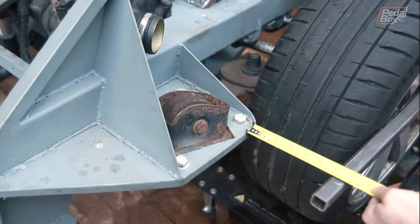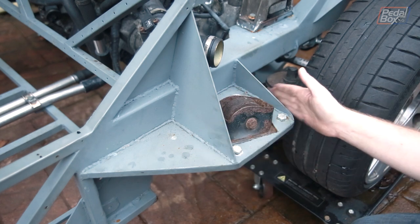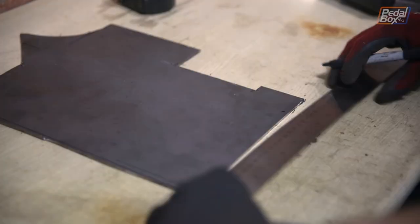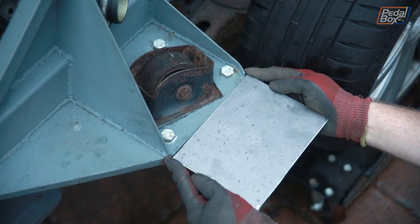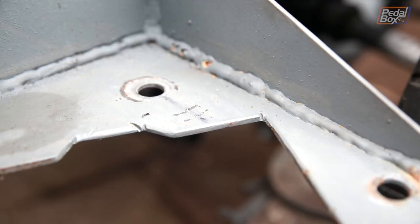Using an inanimate carbon rod we can put this across the side of the tire and see how wide we're going to have to extend it to. To the very outside edge of the tire where the rim protector is, is about 150mm. The plate as it stands is also about 190mm from the back to the very bottom edge. We're not too worried about extending it further because we're only moving it about an inch. This extension is just to keep the bolts captive and so we can mount the intercooler to something. Now we've unmounted the trailing arm we can have a look at the bolt pattern and see where the new holes are going to have to go. This inner rear hole is the most congested one because of the big hole for the arm to poke through.